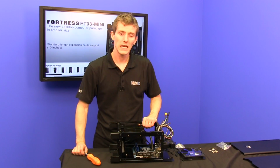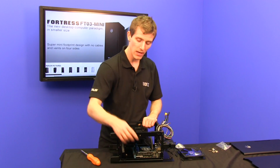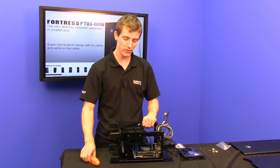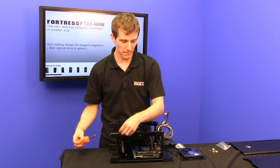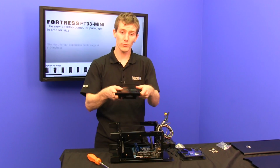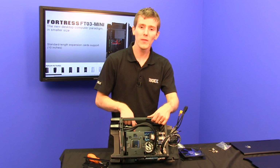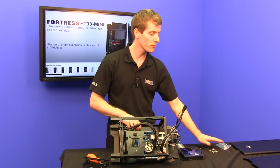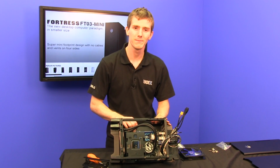before I can screw the motherboard into the case. After you put in the longer screws here for the daughter board power PCB, you have to uninstall the 4 screws here for the optical drive cage, just like that. This allows you to remove it, which gives you access to the other 2 mounting screws on the motherboard itself. So those ones, you use the ones included with your case to secure the ITX motherboard to the chassis.